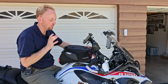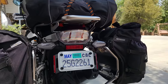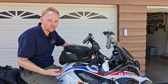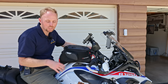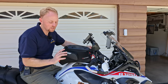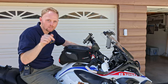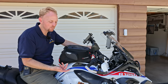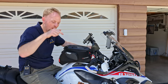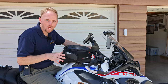I want to show you the cockpit setup, but first let me touch on the tires quickly. These are the stock tires — I think they're Bridgestone A41. I don't even think you can buy them retail; they come as an OEM tire. They're not good — they don't grip great on the street and they're terrible off-road in the dirt. I just wanted to wear them off. Thankfully the front is already bald in the center at just under 5,000 miles — I think because I'm really hard on the front brake. The rear has maybe 40% tread left, but I got a huge metal bracket stuck in the tire. I actually rode the entire last day — almost 700 miles — with a leaking tire, filling it up three times on the way home. I didn't plug it because the puncture was at an angle going into the tire, not a straight puncture. The tires are going in the garbage, and I've got new tires which I'll show in a few weeks.